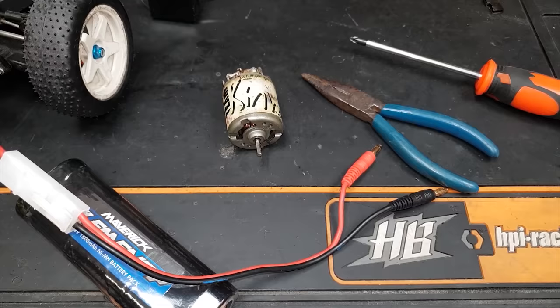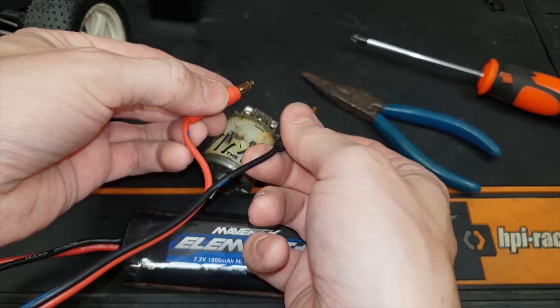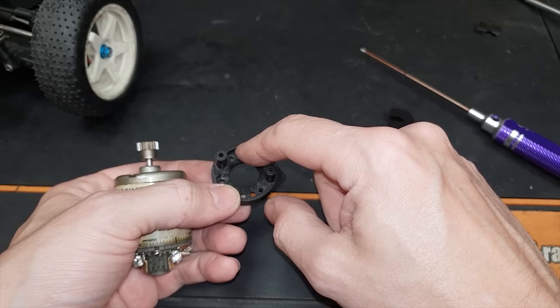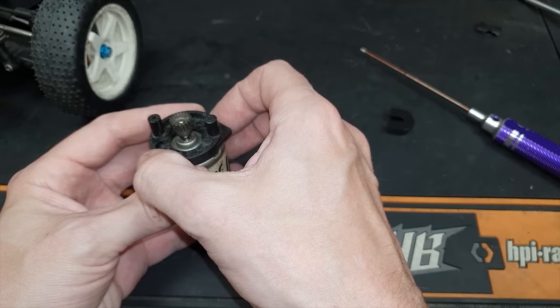Next I want to see if this motor still works. I've got an old battery pack - I'll plug it into a charge lead and touch the terminals to see what happens. It works! The way you set the pinion distance is with this little tool that comes with the kit. Then to set the mesh, it's got a series of holes - I've got a 19 tooth pinion so you line that up with the 19 tooth hole, screw it on and the mesh should be set.